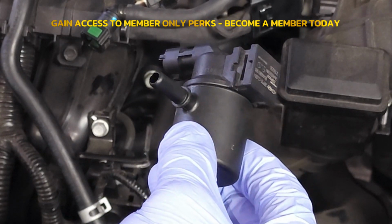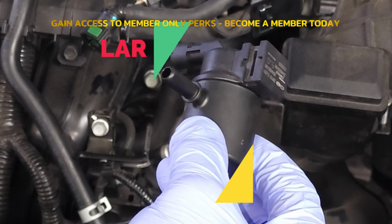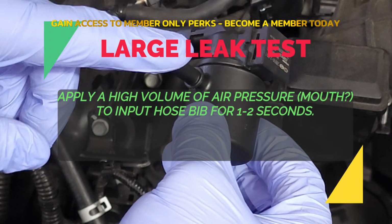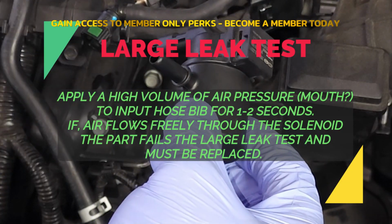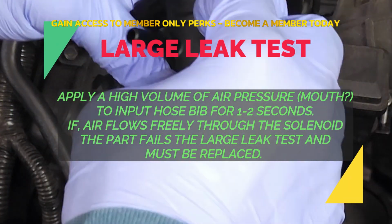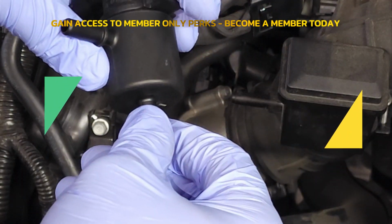For the large leak test, you apply a high volume of air for a very short period of time, just 1 psi to this hose bib right here. If you blow air in there and it flows freely out that back side, that means this valve is no good and should be replaced.